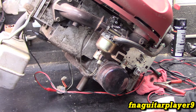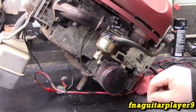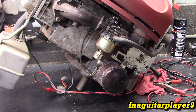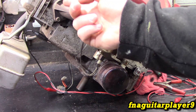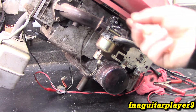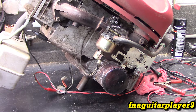If you've ever seen an older engine — like you've been cutting grass or on a tiller and you shut it off — then after the engine stops spinning, a couple seconds later it'll go kapow, backfire out the muffler. What's happening is when you turn the key off, your engine is still turning over and still pumping a fuel mixture into the engine. That builds up inside the muffler or exhaust, and a piece of glowing carbon will ignite it, causing a minor explosion in the muffler.